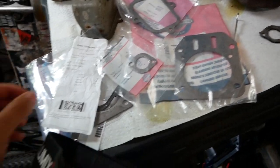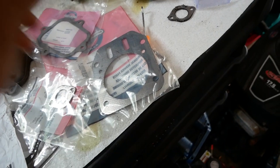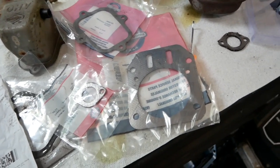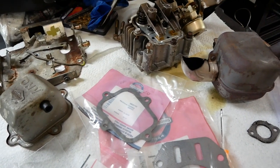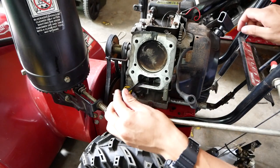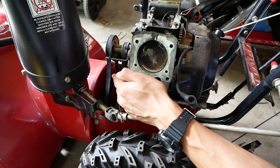We're back with some parts. I already got the pull cord installed — got it for like $3 and change. We have exhaust gasket, head gasket, valve cover gasket, totaling in at $22.30 — so $25 in parts to fix this thing. Just got to make sure these sealing surfaces are all cleaned up, put these $20 worth of gaskets in and sell this machine. Let's find TDC so we don't have to fight against this thing — the compression cycle. That's top dead center.